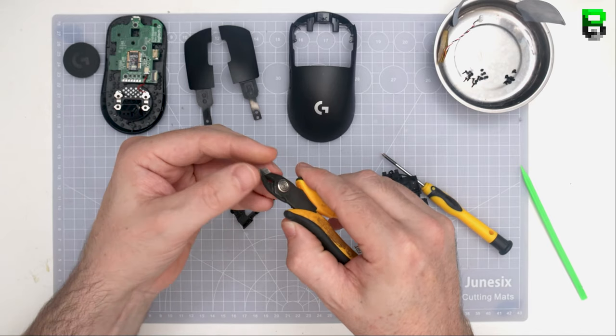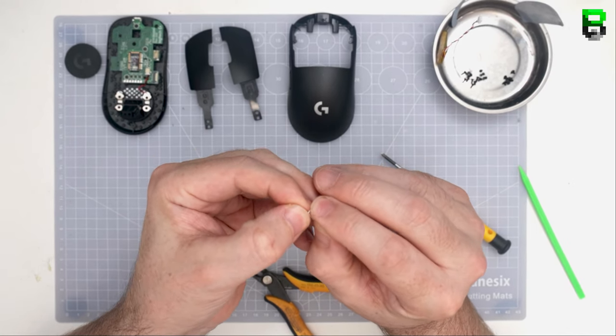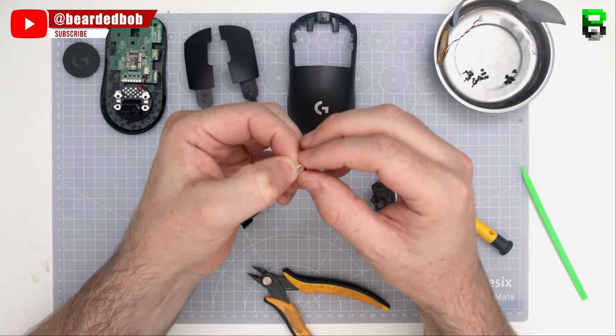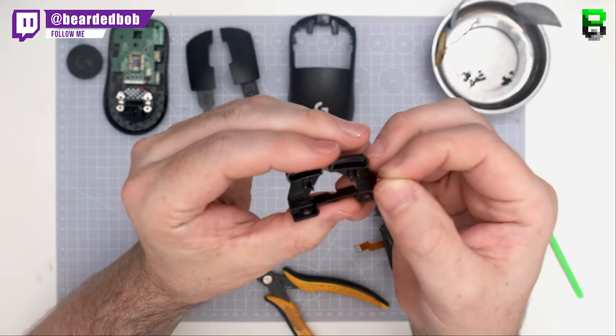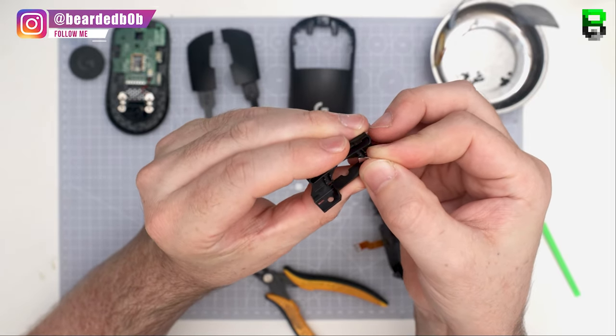There's black tape, this is aluminium, which I find to be slightly better. And this stuff is very sticky. You have to keep adding different bits of tape layer on here. So the first initial part, two bits of tape are fine. When you start adding three bits, four bits, five bits, you've got a lot of pre-travel there. And the more tape you pile on it, the more chance it has to slip off. So you want to be very careful.